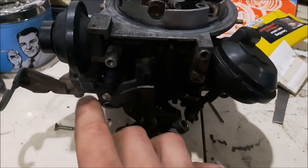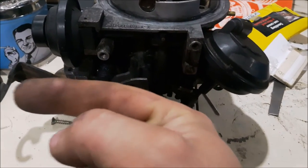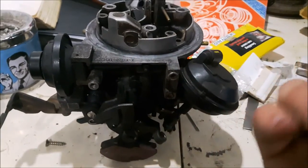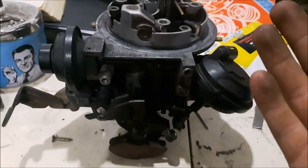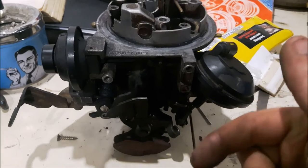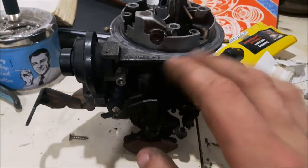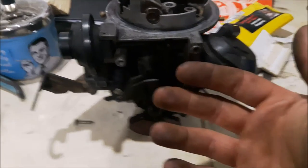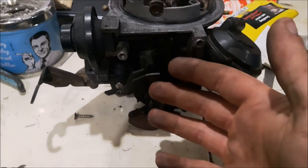The wax stat starts out at maximum withdrawal and allows the throttle to sit anywhere between 1,200 and 1,600 RPM. If you've got a boiling hot day and the coolant's already warm, don't be surprised if you fire it up and it blips up to 2,000 and drops straight to 1,200 RPM — that's perfectly normal. When it's really cold you might get a cold idle speed of anywhere up to 1,600 RPM. I've had 1,800 on mine on really cold mornings, but it always comes down to the right idle.